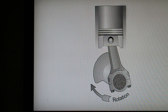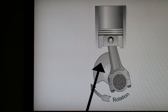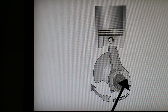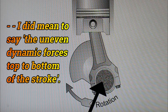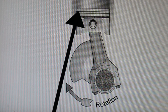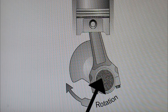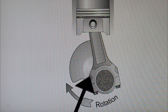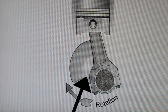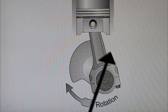What we see here is the basic system which we're going to balance. This counterbalance weight here has to offset acceleration forces developed by the motion of this piston up and down the bore as driven by the crankshaft during its rotation. We can't completely balance a reciprocating load with a rotating offset mass, but by connecting lots of cylinders as we have in a V8, we can offset some of the reciprocating forces on one cylinder with those on another.